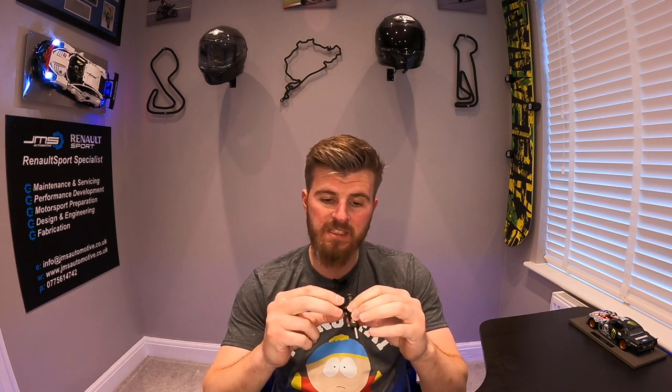Coming back to the fuel filter in the tank — in the E46 M3 you have a pickup pump in the fuel tank which moves fuel from the pump into the injectors. Underneath the car there's a long cartridge filter, it's a serviceable item you change every 30-50,000 miles. But in the E92 M3 it doesn't have that — it's just a lifelong filter built into the pump itself, not a serviceable item. Generally if a filter fails it clogs up and you'd have a fuel supply issue. But some people are saying particles can unfortunately go through that filter and end up getting into the system. All the diagnostics I've seen is people having the car cut out and run really badly. Upon inspection they've removed the spark plug just to be greeted by a cylinder completely filled with unleaded — which is obviously not a good sign.